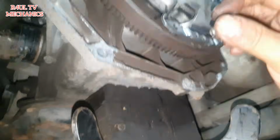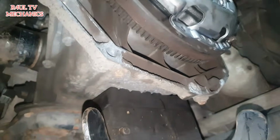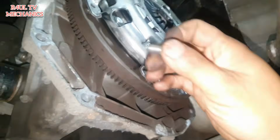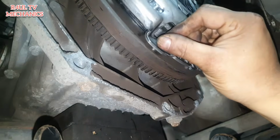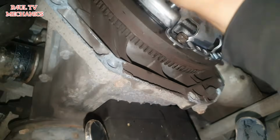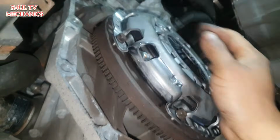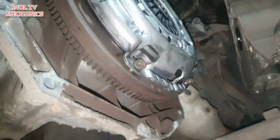Let's go. Right, so as you can see there, I've got the clutch in there. Obviously, I had to put it in and get a few bolts on, so I couldn't show you and do it at the same time because I needed two hands. So get the clutch bolts on, but don't tighten up on them just yet. I'm going to get the clutch lining up tool on there. If you haven't got a clutch lining up tool, then I suggest you get one, or use the old-fashioned way, a stick or an extension in there just to line it up basically.